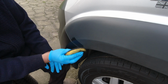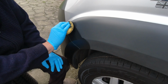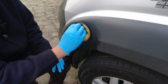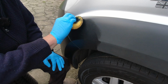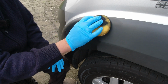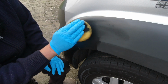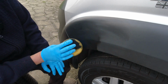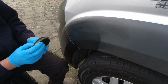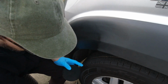All you need to do is wipe it on. The instructions say to use a combination of circular and straight rubbing. I think the circular is to try and get into the grain, and the straight because as it's a dye, it is a little like painting, and you can see your brush marks if you're not careful. And it does say you should do at least 2 coats, and I agree, because you kind of got the brush marks left behind by my pad, and even if I thought that was dark enough, it's not even enough. So we get our next coat.